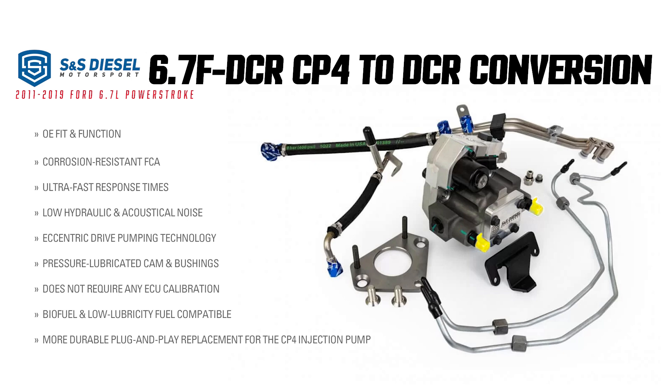Until recently, we worked with Stanadyne Pure Power to adapt this DCR pump, which is a current production pump — a variant that has been in production for several years. There are lots of them out there on heavy duty engine applications in other parts of the world, just never here. It needed some changes and adaptations to work with the Ford. We've been working on that for a while and released it in the middle of 2023 when we launched production. It's had great customer feedback and reception — everybody's excited about finally having a permanent solution. Previously you had the disaster prevention kit to keep the rest of the system from getting contaminated; now you've got a complete pump replacement where you get rid of the problem child altogether and get a more robust, reliable pump.